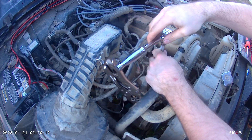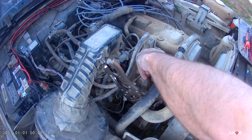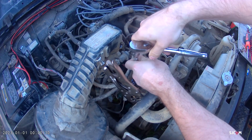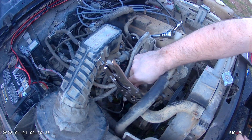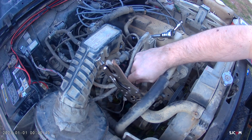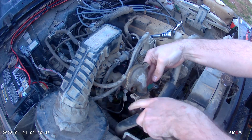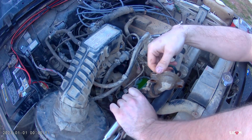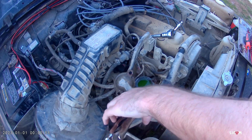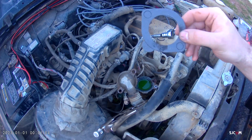And we're back ladies and gentlemen. It took a little bit longer than I expected to get a thermostat and order it — so go figure. We're taking this back apart here. If you remember before I paused the video, we put these screws back in there so we don't lose as much antifreeze. We'll just slide that off here. Make sure you take the old gasket off — this one about disintegrated, about gone. That's okay, we got it all off though. And we got a new gasket here, part number 2168.